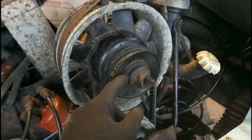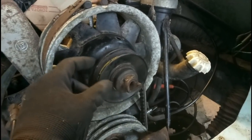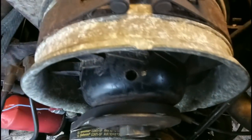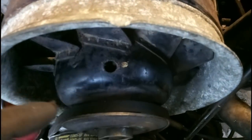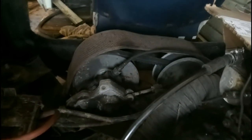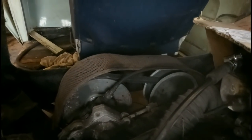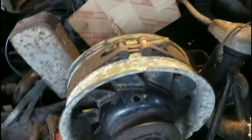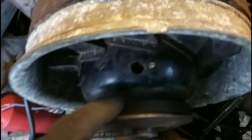So I'll give that a go. I've got all my shims here at the moment. I obviously need them further back to increase the tension. I've packed that gap out and the belt's got looser, and that's because it's working on the same principle as the transmission. Those pulleys get closer and they have a V on them, and that makes the belt rise up. So effectively the belt pushes up, which increases the gearing. And that's exactly the same principle here.